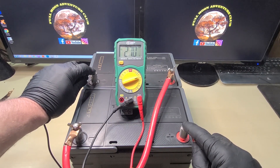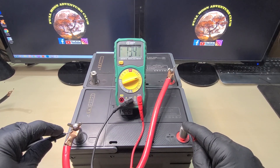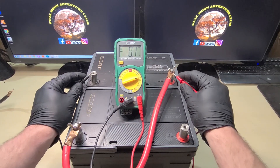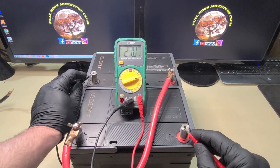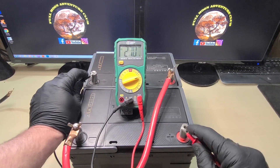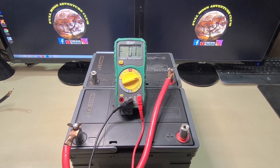So that's the way you want to connect your RV. You can see that each battery is still putting out about 13.5 volts individually — 13.5 and 13.4. The real magic happens when you bridge the connection from battery one to battery two, and then you can see we have double the voltage. That's how you would connect your RV if you wanted to double the voltage — by going across battery one and two, positive to negative.